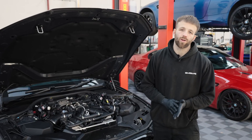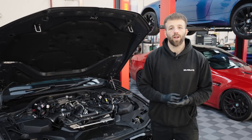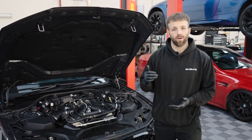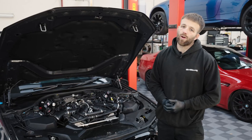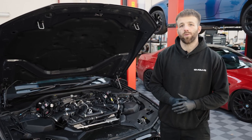At this point, if you want to, you can reconnect the battery on the car, which allows you to close the boot and lock all the doors. If you've got an M8, this also allows you to close the door because the window will then function. It is also a good idea to put a trickle charger on the car if you have one, to stop the battery from dying while the ECUs are out.